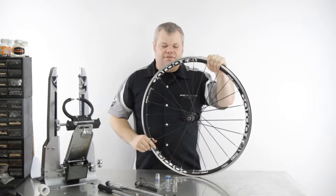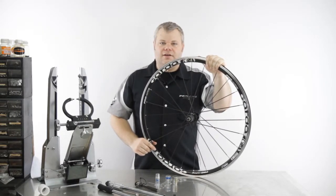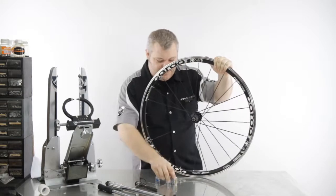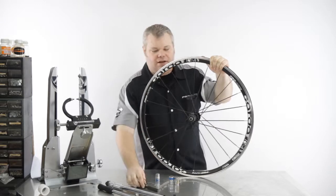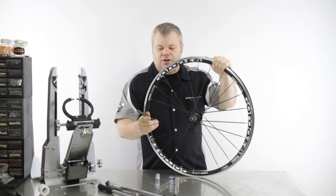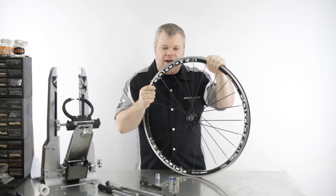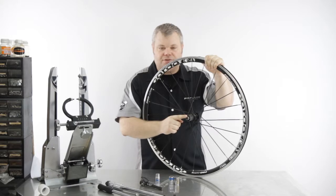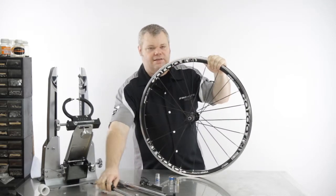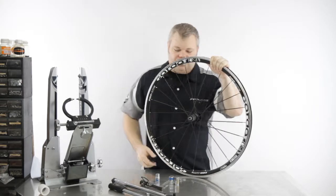So this is the video for disassembly and maintenance on the Garda. The tools that you're going to need are two 18mm sockets and a 12mm half-inch drive long hex key, a 2mm hex key for the grub screws, and you will need also a torque wrench, as well as you'll probably want to use a basic driver, half-inch drive.